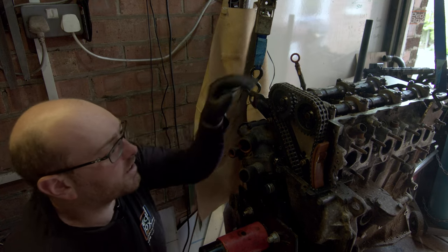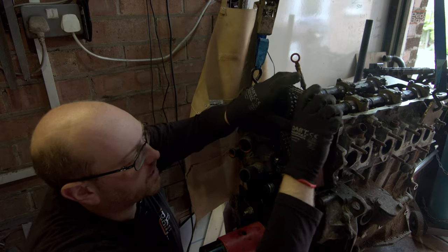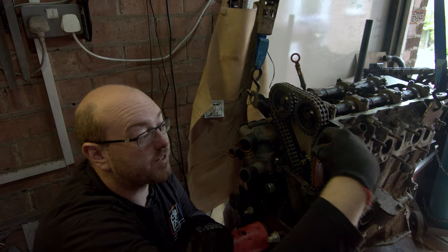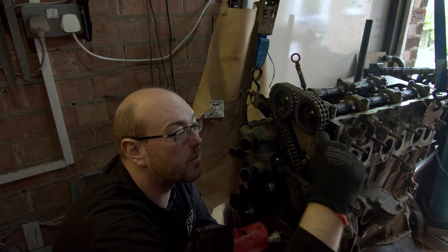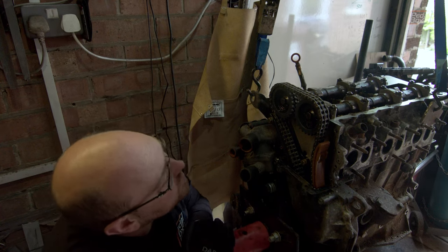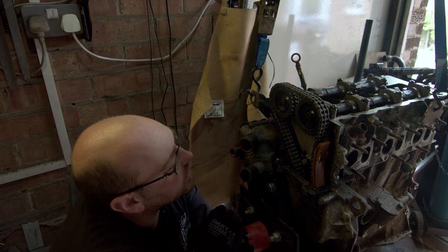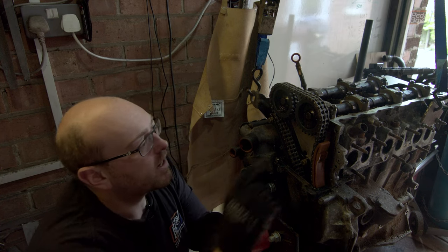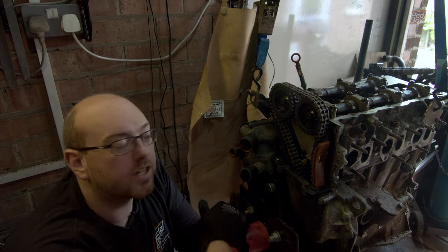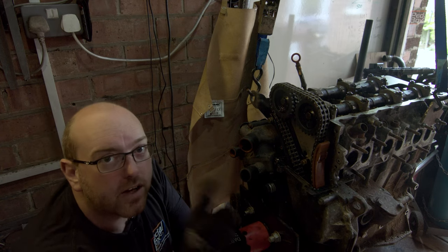With the cover panel off, we can take a look inside. With the crank in the right position there's enough gap, and I can actually see down the back of this guide. There is some wear down the back edge - I can get my finger in the top end there and feel a couple of grooves from the edge of the chain, so it's almost certainly worthwhile replacing these guides. The chain itself looks okay, but I couldn't tell you by visual inspection alone whether it's done for or not, so I'll have to look into how to inspect it. The guides themselves almost certainly need swapping. I'll take these off later, but now it's time to start taking the head bolts out.